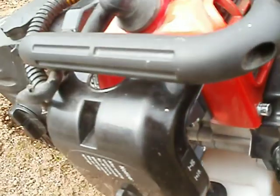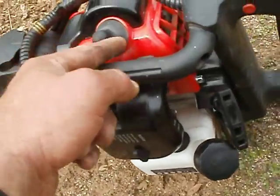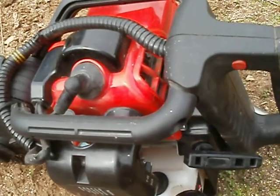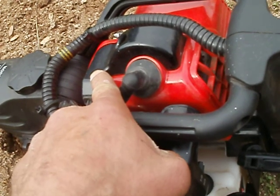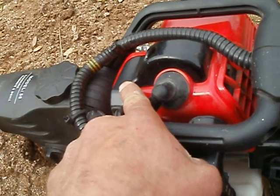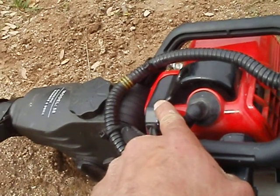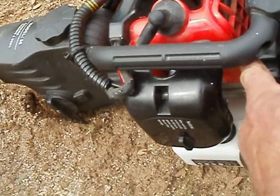Let's see. This one I did modify. What I did is I took a piece of solder, took the spark plug off, stuck it in, gave it a pull, made sure it touched the side, and I got squish. You can, on two strokes, basically get away with 0.020 inches of clearance. That's 0.02. It was like 0.04. So I did get in there, take off the head gasket,